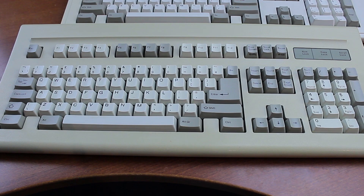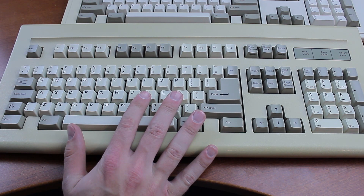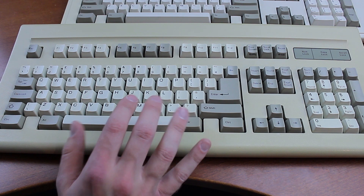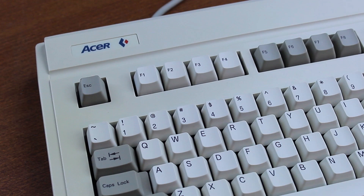Also please bear in mind that most boards that came with blue Alps also later came with other switches. Especially Chicony keyboards like this KB5161 — this model could come with blue Alps, white Alps, blue Cherries, several types of Cherry clones, Omrons, and Mitsumi Miniature Mechanical switches — so always check for a photo of the switches. That's it for this video. Thank you for watching. I hope you enjoyed it, and following is a typing demonstration of me typing on this keyboard.